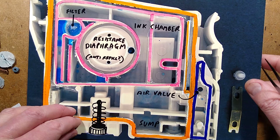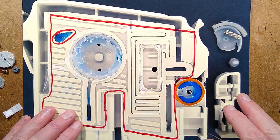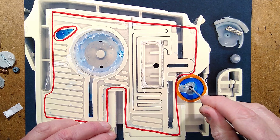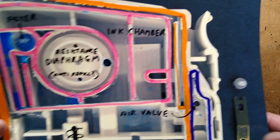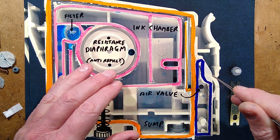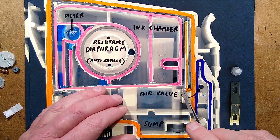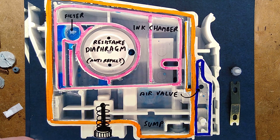When you slide into the printer, there's the little pin that gets pushed in. Because this is a diaphragm, the diaphragm doesn't get punctured - it merely uses it as a drum skin. The diaphragm pushes in and pushes down against that little pin, and the air can get through to this side. The air then couples into this chamber here, down to the bottom. Then that chamber, when the diaphragm is pressed, couples the air to this chamber here, which goes to the top - again this is to make sure the air enters at the top of the cartridge and not the bottom. The air then flows down and can now find its way up inside this chamber here via that little slot in the back and into the ink cartridge, so it can actually release the pressure of the ink. It's ridiculously complex.